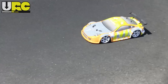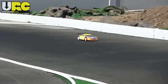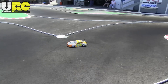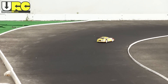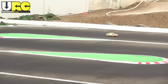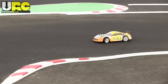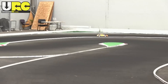It got around the local on-road track pretty well, but it still had a lot of body roll. Elite racers will hate that, but to me it just seemed realistic and it's actually fun to drive like this. It has pretty respectable acceleration and great brakes. With the tires warm, the car has understeer both on throttle and on the brakes, while it's a little better at neutral throttle. On another test day, I tried a different tuning setup. Still using stock suspension components, I was able to tidy up the car's handling quite a bit. I did swap in a Power HD 1501 servo — that cost 12 bucks. With this round of changes, I picked up a little more positive traction at the front and also loosened the rear just slightly, letting me drive with a little more aggressiveness and consistency.